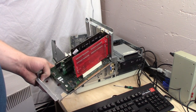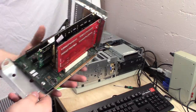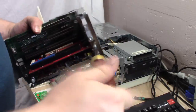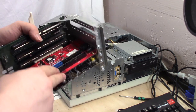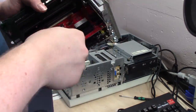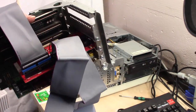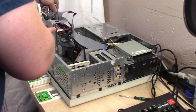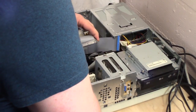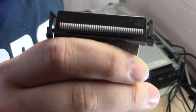Right away we've encountered a problem — all the cable ports are blocked. So I gotta swap this with the graphics card. That makes me uncomfortable, but okay. That's a lot more practical — I should be able to do that. And as long as I don't fill up all the ISA slots, this should be sustainable. Wow, now that I have not seen in ages — an IDE connector with retention clips. Oh, there's no need for that.